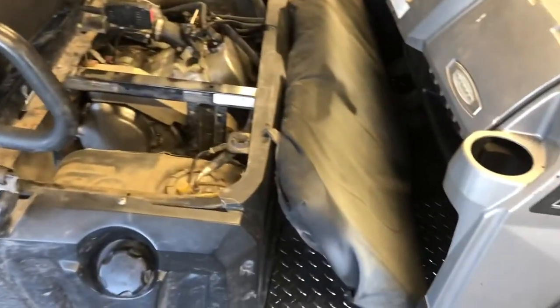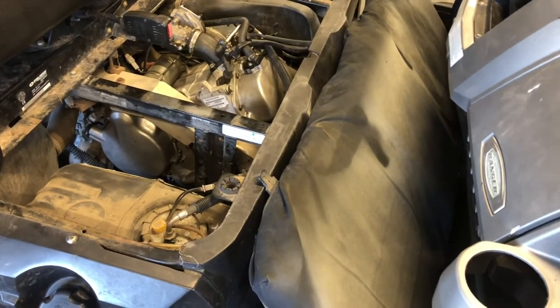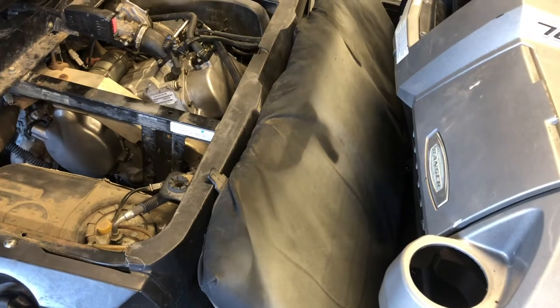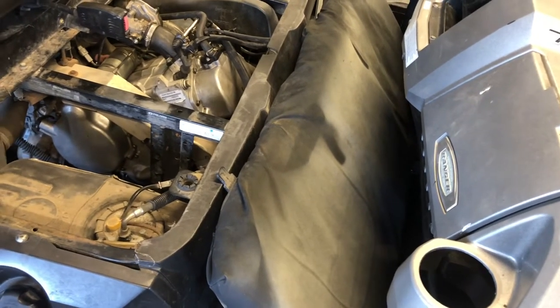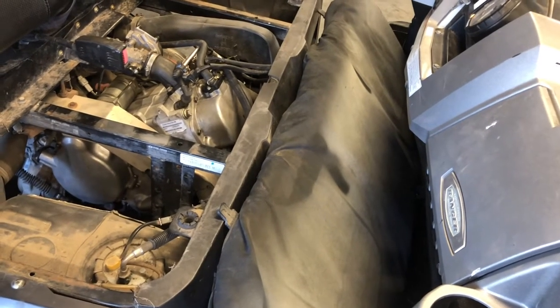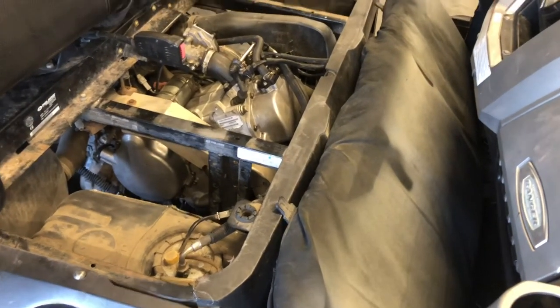You've got a high and low on your overflow, so make sure that is in the position that it needs to be. You can run your Ranger with that radiator cap off and I like to do that just to suck as much coolant through there. If you've drained your coolant, do that, and there's a cap on your engine — I'll show you in a separate video how you get the air out of your system when you're first putting coolant back in after you've drained it.